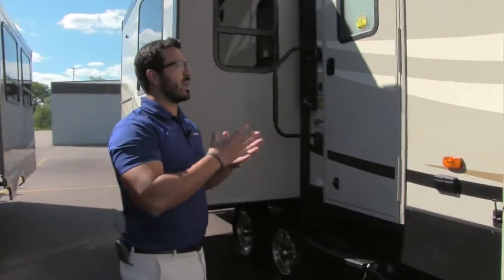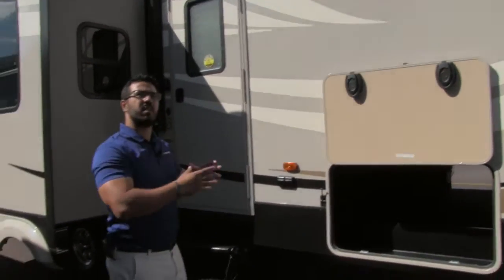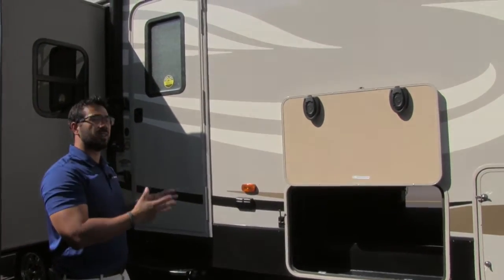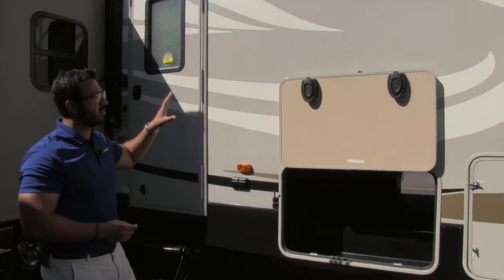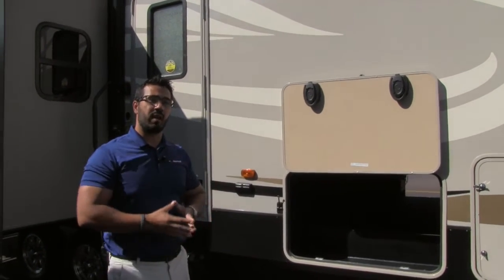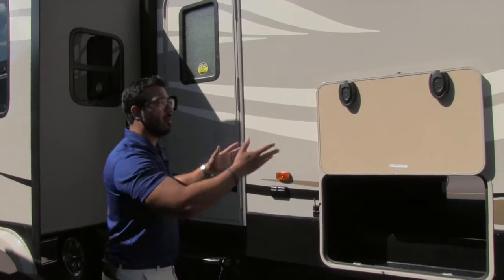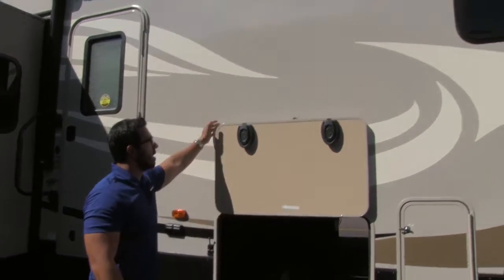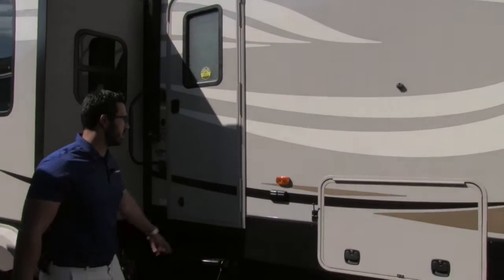Let's talk about that aluminum framing — this actually has a very unique construction method. It's built like a house: studs 16 inches on center, but all aluminum studs. In between they have fiberglass, but what the Phoenix does differently than a lot of other manufacturers is they also include a layer of astrofoil. A lot of manufacturers will put that in the roof and the floor, but nobody's putting it in the wall, so that's a huge advantage for insulation properties. It is a slam latch so you just drop it and it shuts easily.